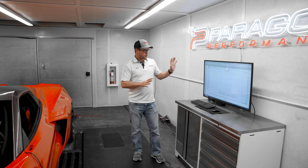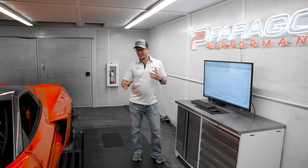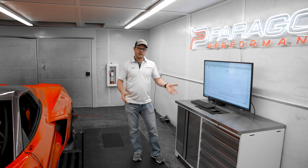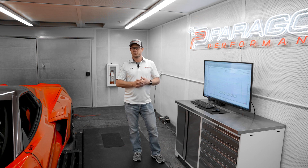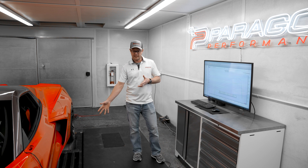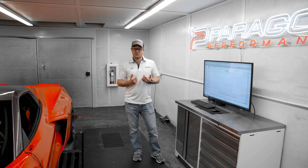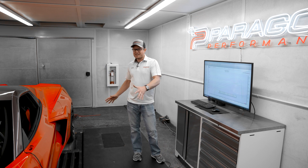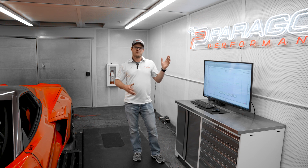All these numbers that we're showing you guys are with standard correction. You guys had a lot of questions in our last video about differences in dyno numbers, even amongst other dynojets. I could do a whole one-hour video on dynos and corrections and different types of dynos — there's a lot to unpack there. If you're interested in understanding dyno numbers, do some research. There are lots of existing videos out there that can help explain the differences between Mustang style dynos, hub dynos, and dynojets like we have here. For the sake of comparison, from my many years of experience tuning, dynojets to dynojets are the easiest to compare. They're an inertia-based dyno, which means they just spin a drum and measure how quickly it's accelerating. That makes them a lot easier to control the factors. To make the numbers comparable from location to location, dynojet uses something called a correction factor.